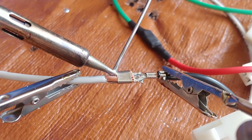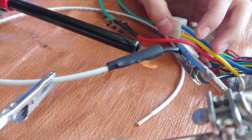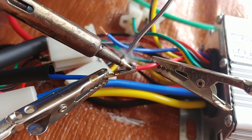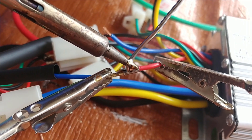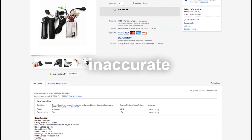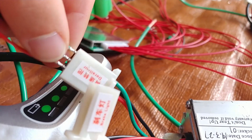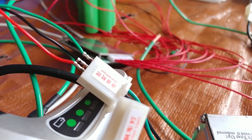We soldered and heat-shrunk the battery connections directly, which we later made pairs of disconnects for. Hooking up the motor controller was pretty confusing since there were no diagrams to go off of — all we had was a gut feeling and an eBay listing. The throttle connections fit nicely when wedged into the controller's disconnects, and the motor just so happened to have the same disconnects as the controller.